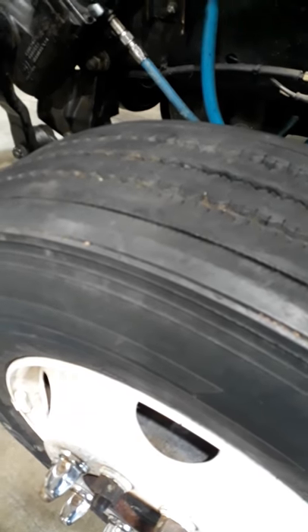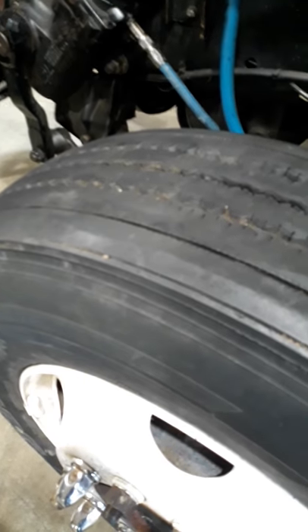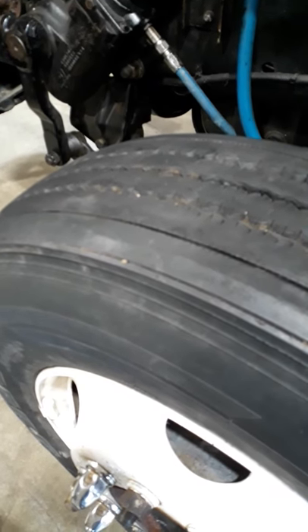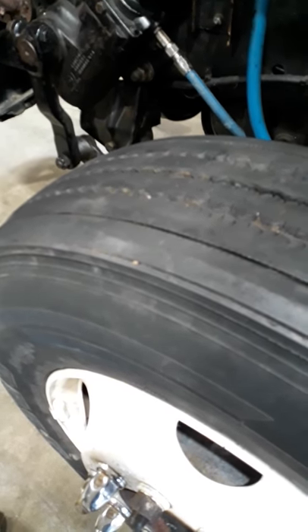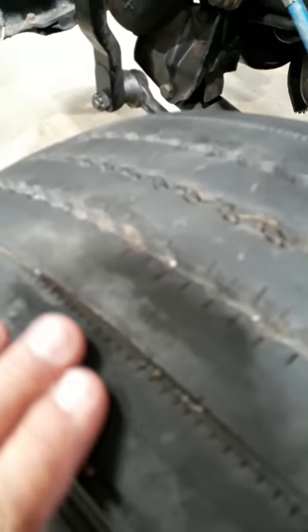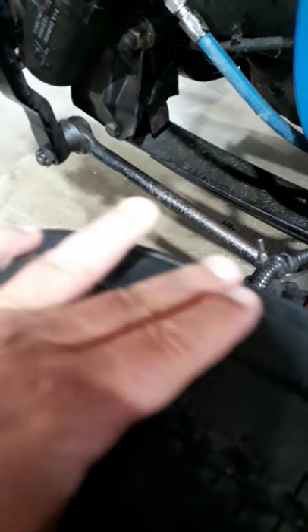Now as far as inspecting the tire for wear, you might think if it's got weird wear patterns we're going to replace it, so why do I need to look at that and diagnose what's going on? The reason is there's probably an issue causing that particular tire wear, and we want to be sure we address that issue. If not, the new tire will just fail in the same manner and shorten the tire life — and tires are very expensive. Inspecting this tire, it has some uneven, wavy wear pattern — low spots and high spots along the outer edge, and a little bit on the inside tread as well, so it's kind of an odd wear pattern, not even universal across the tire.